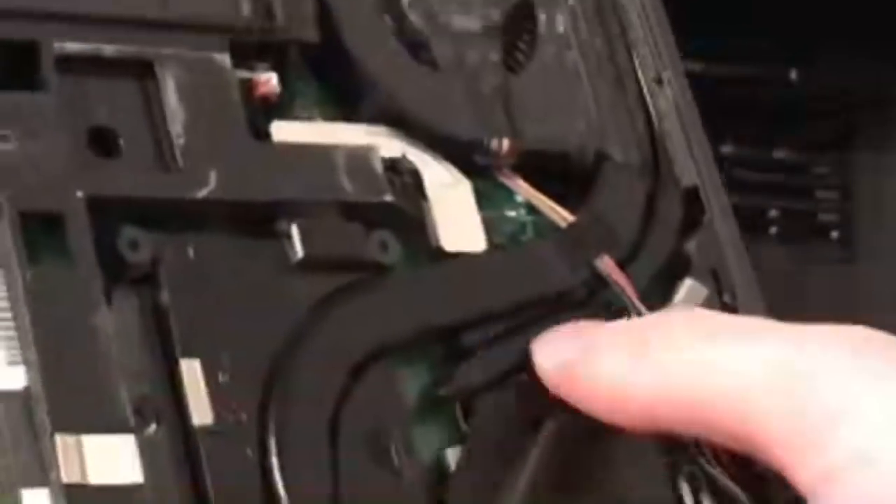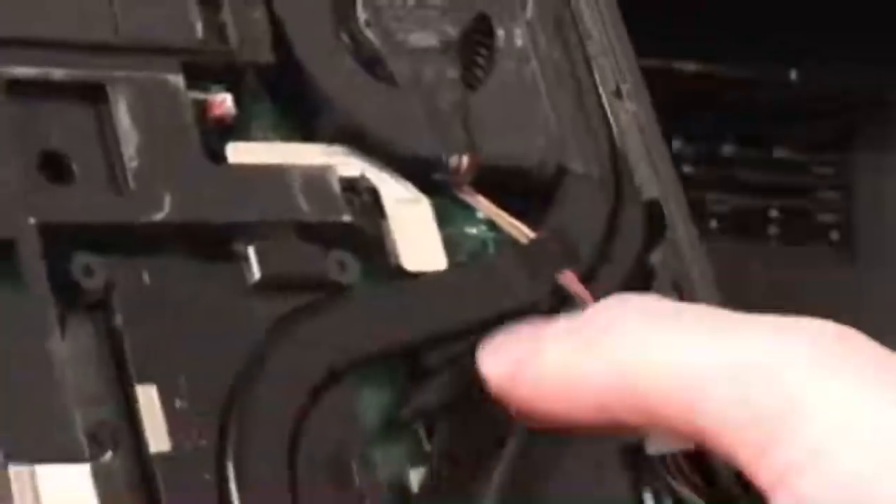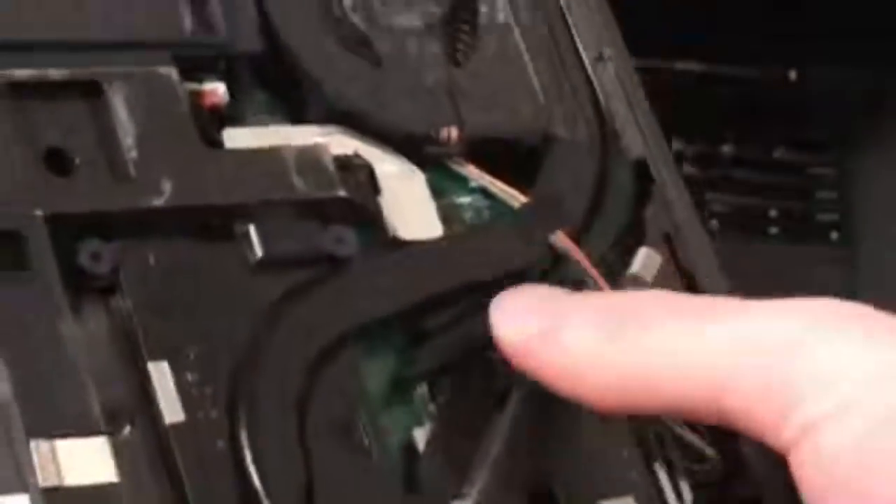From the comments: If I have a few T440ps, is there an easy way of knowing which video card you have without installing the OS? It's actually very easy. On a T440p with dedicated graphics, there is an extra fin on the cooling assembly going over a small chip. This fin and chip are not present on the Intel graphics models. So if it has Intel graphics it just has the base heatsink; if it has a GPU it will have this extra fin. That's how you know the difference.